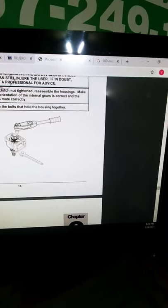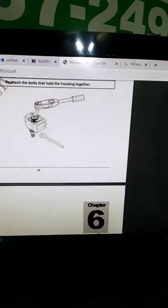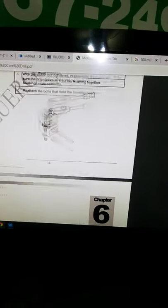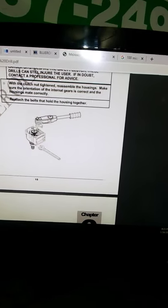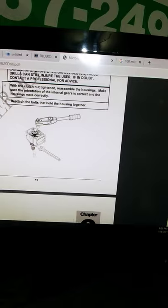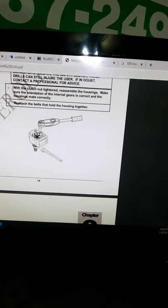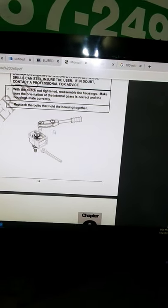If you look inside, you'll only see one nut — it's pretty obvious. Basically this is the shaft that comes down and spins the drill, and then you have the motor that comes in from this side and ties onto the gear. What will happen is if you bind the bit, it prevents a whole bunch of snapping of gears in here, and this gear actually starts to slip — purposely slip.